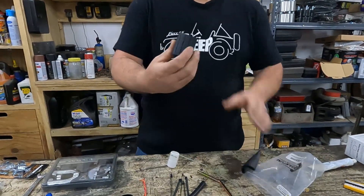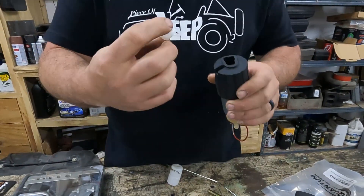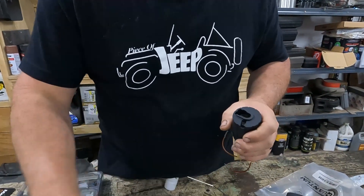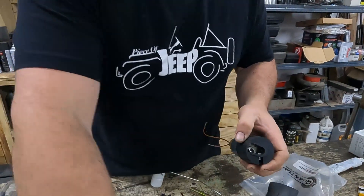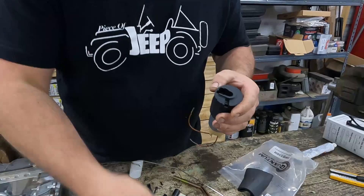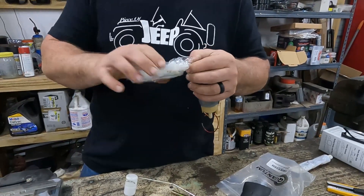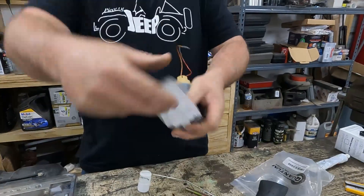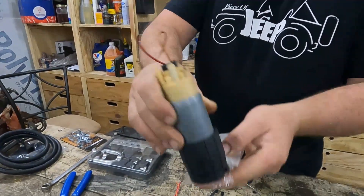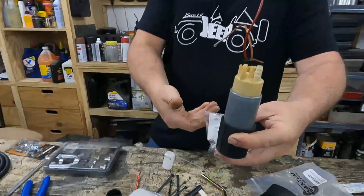What we're after is this boot — it fits on the end of our fuel pump like that. We don't want a strainer that will tip up. We have a whole assortment to choose from here. I like that one. We're going to put it in here and face it towards the back so that it will sit on the flat part of our tank.